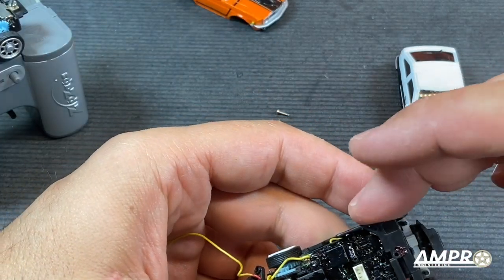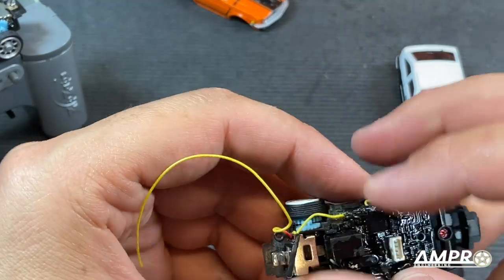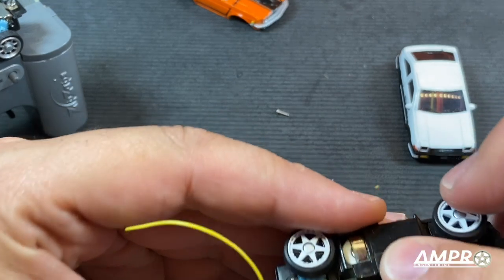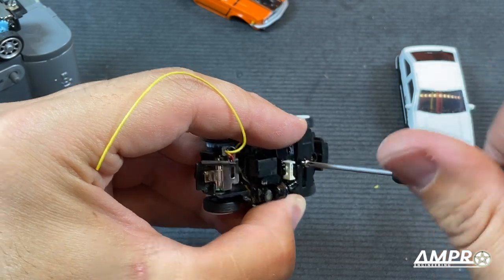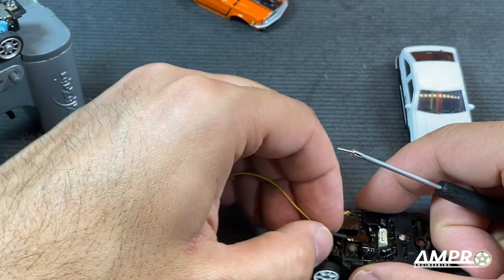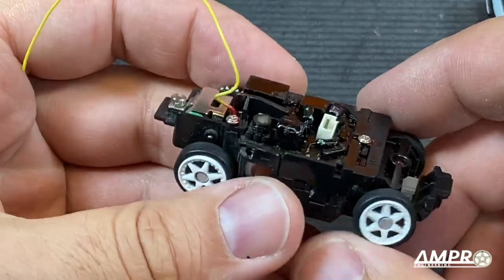So that goes right back in here. And again, you want to be careful with these things. They're not getting any younger. Okay, cool. That goes there. I believe that is lined up. This goes smack dab on top. And remember to back thread the screws to prevent stripping out the threads here. So that goes in. Then you get your retainer, which is still on the antenna. Flip it around. Set that on top of the little crystal. Just like that. All right, so that is reassembled.